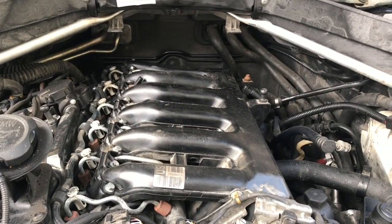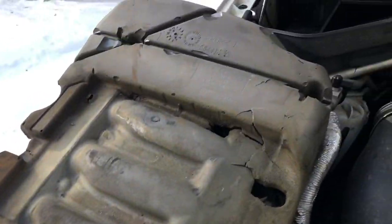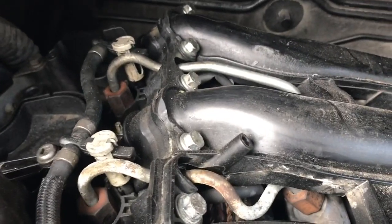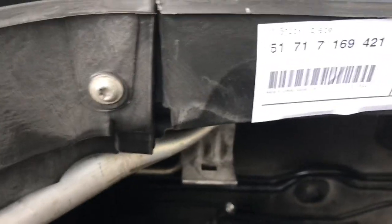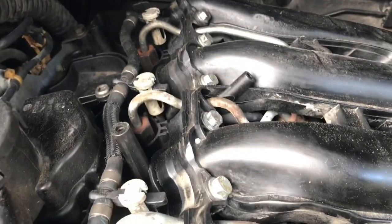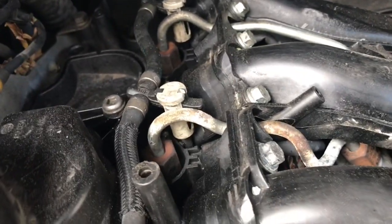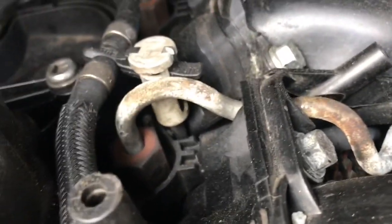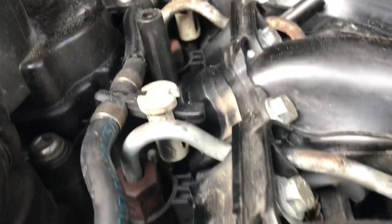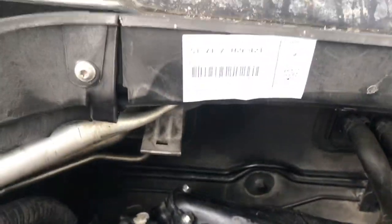Now I didn't have to take the air breather system out, but I wanted to replace this because we had taken it out because we had to replace injector 6 and injector 4 are new. But you can see the corrosion on the lines from the water dripping down from here onto the foam, and then the foam holding it and dripping it slowly onto the injectors and onto the fuel lines. And so these valleys fill up with water down in here and short out the fuel injectors. As you can see, mine are quite corroded back there where the water was dripping down from here.